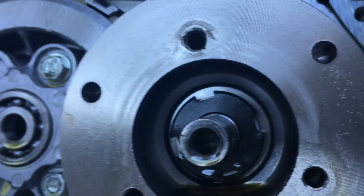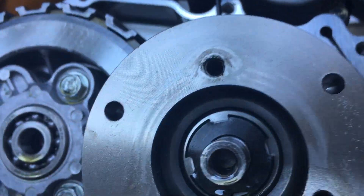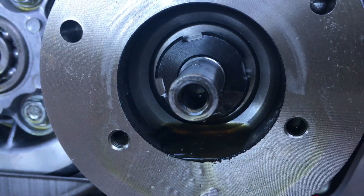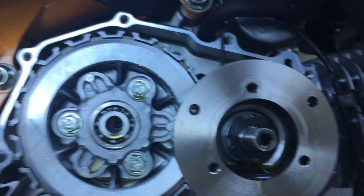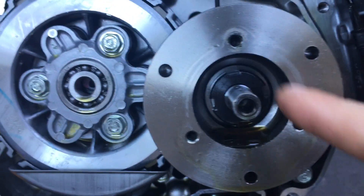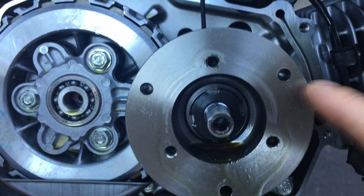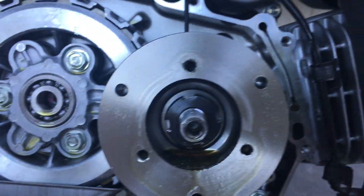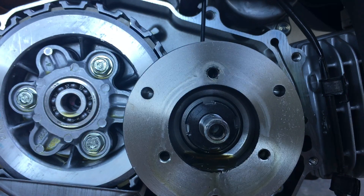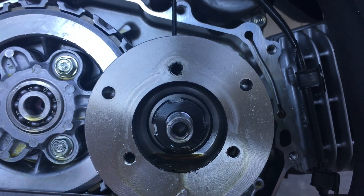That's the clutch material, so it's not that much crap compared to the first time when I took this off — the first time there was definitely a lot of crap. I think because of how much volume there is in here, you could probably go like 10,000 miles before you need to take this off and clean it out, maybe even more than that. So you don't need to do this often. Some people say do it every time you do the oil change — no, you don't need to do that.